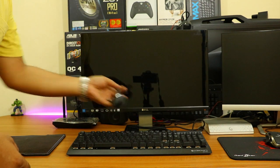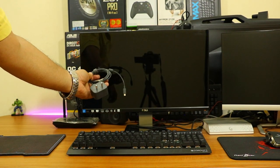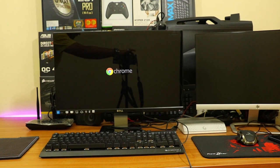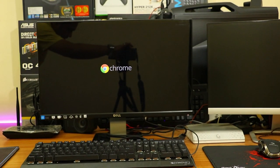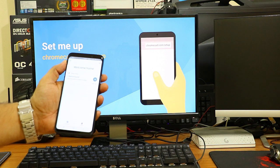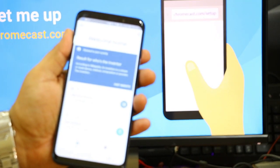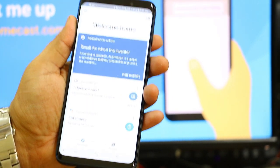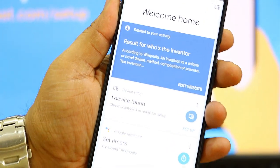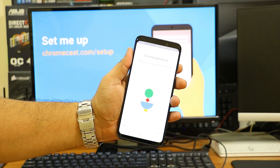For the demo I'll connect this Chromecast to my monitor. Note that on a monitor it won't work on HDMI power alone — you have to connect the power adapter because the HDMI port doesn't supply sufficient energy. Once I connect the power adapter it starts up and does the initial setup. First you have to download the Google Home application on your mobile, then log in and it will ask you to connect a device. It automatically finds your Chromecast because both are on the same Wi-Fi network. Just click Setup on the right-hand side — it's very easy and takes about 5 to 10 minutes.